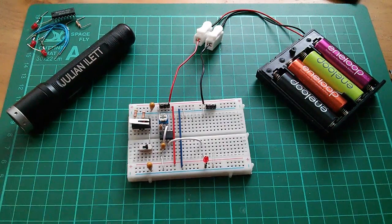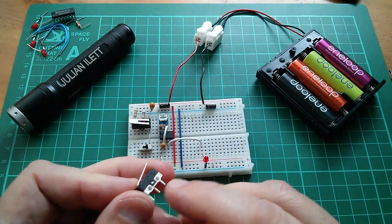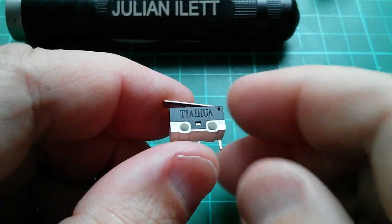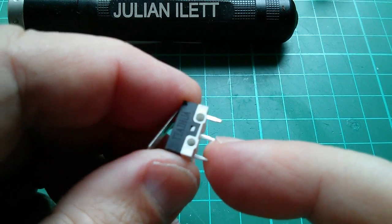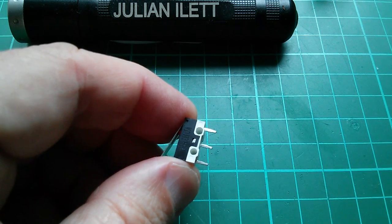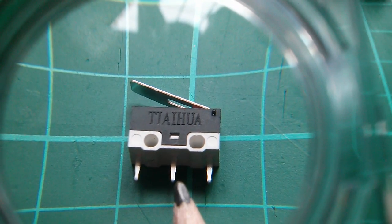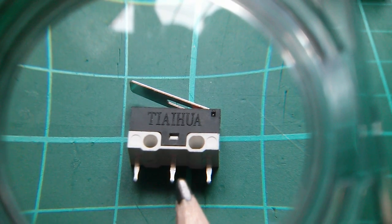It is very tiny. I've got 10 of these. Here's a spare one - it's got these little tabs so I think this should come apart fairly easily. This micro switch is very breadboard friendly. It's got pins spaced exactly two tenths of an inch apart. They're shaped with a little bit of necking there, and that means it fits into the breadboard contacts almost with a click lock. So it does work very well in breadboard.